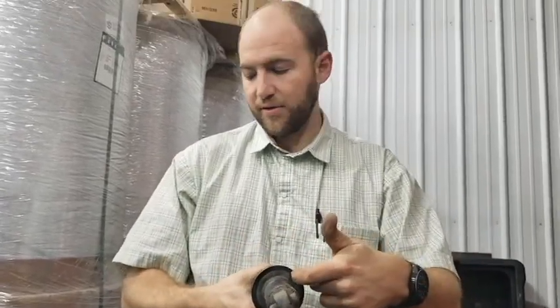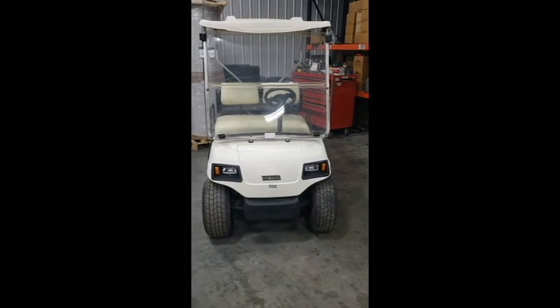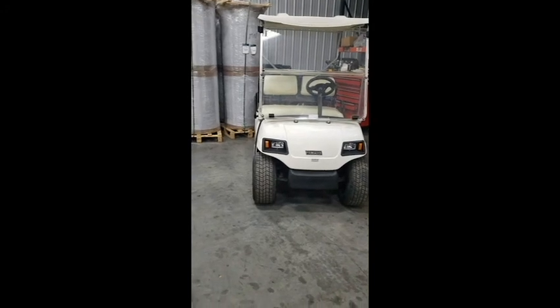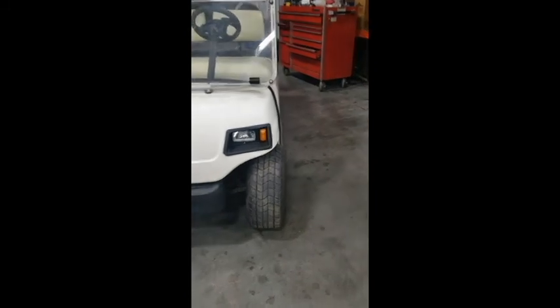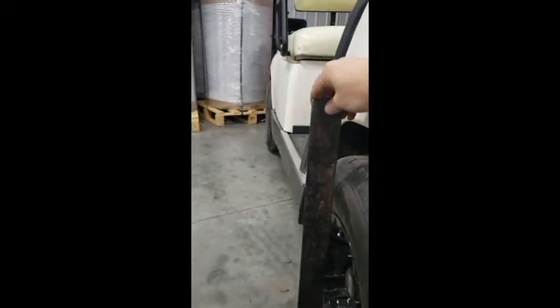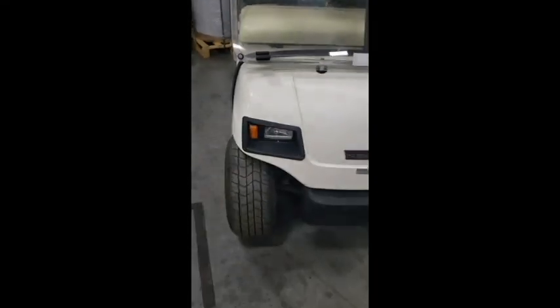It's sticking a little bit here. I'll show you how it looks once I'm done. I got the shocks back on. I'm still seeing a little bit of positive camber, but once I got two 200-pound gorillas on there it should level out. Not too bad — driver's side is a little bit more. I'm seeing approximately a half inch down here and about a quarter inch down here. Overall, not bad.